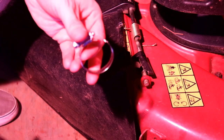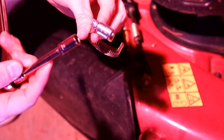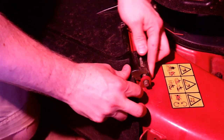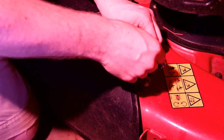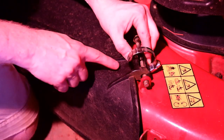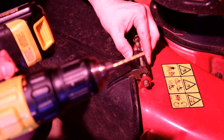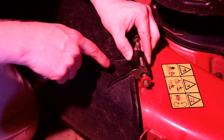What you're going to want to do is loosen your hose clamp all the way out using your eight millimeter socket. I'm going to center it up front to back in between here. I'm using an eighth-inch drill bit so there's plenty of room and I won't risk the clamp cutting into the plastic.